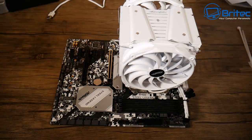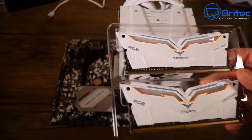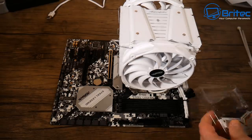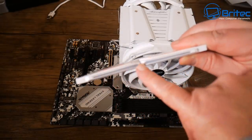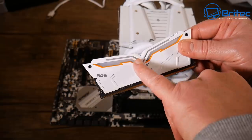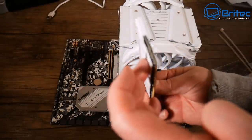The first thing you need to do is buy the right type of RAM — DDR2, DDR3, DDR4, whatever applies to you. In this case we're talking about DDR4. This is 3600 MHz speed and this particular motherboard doesn't quite go up to 3600 MHz, but I bought it because I wanted white memory. It's a Team Group RGB kit, which is popular today, but beyond RGB and color, you should also look at the profile height of the memory to make sure it will fit with your cooler.